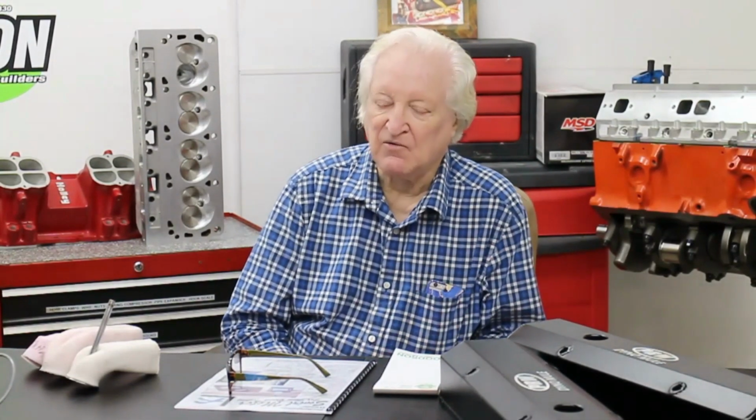If you are testing a rocker which has a slow rate off the seat, it is unlikely that you will have to change anything that you had before. I say unlikely, that doesn't rule it out. I had a set of rockers where the ratio was slightly less coming off the seat, and so the overlap triangle didn't change, and I found that the advance stayed the same. Advancing or retarding when replacing the 1.65 rockers with a 1.85 did not change.